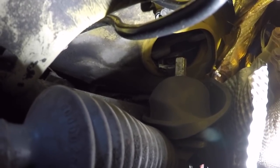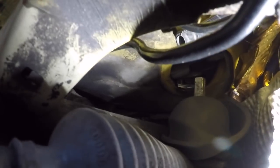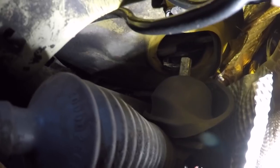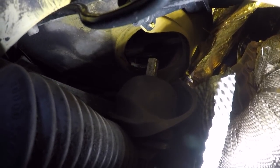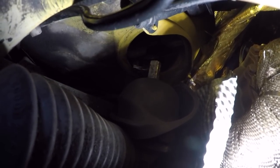Right then, from my best experience, is to get into the car, get it up in the air, and there is your steering rack. And I've actually disconnected mine already. What I've done is, if I can get my hand up there to show you as well, I pulled the rubber boot back, and then you'll be exposed to a 13mm nut and bolt. And what you want to do is remove the nut and slide the bolt out, which is sort of triangular shape, so it has to wiggle out in a certain way. Just give it a wiggle, a twist, and it will come.